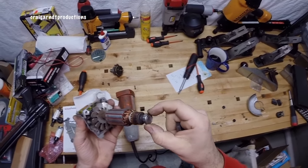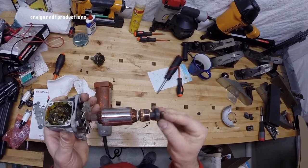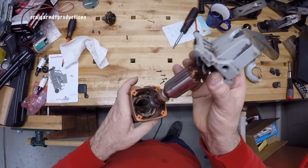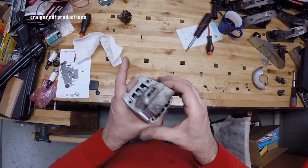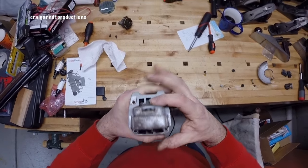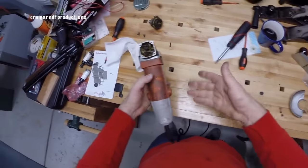One important thing — you'll notice there's a ball bearing on this end which spins really freely. There is a rubber cap that goes over that, and it's going to prevent the armature from swinging wildly. I had forgotten to put that in, and that's why it was making that noise. Now it's not making that noise because the armature isn't fluttering in there. Get that snapped in and put back together.